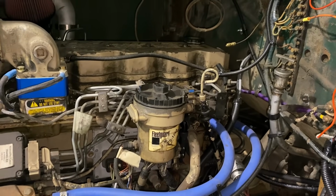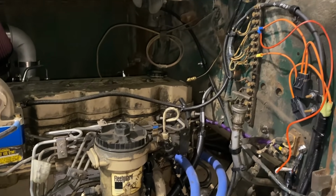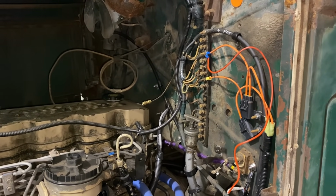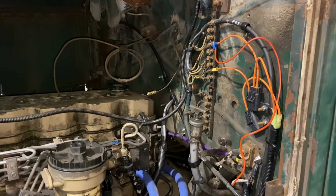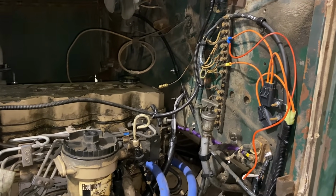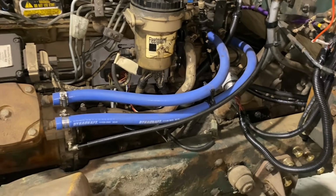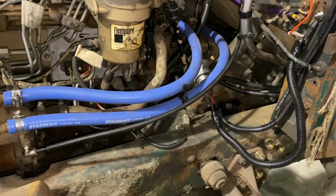The Kaiser buzzer is making noise. I think it's just low air pressure, like it should be, I think is what that is. So as far as that goes, it's working properly. The starter switch won't try to do anything, and the lift pump won't ever kick on, so I really don't think we're getting the proper signals out to the engine.